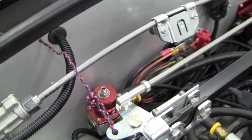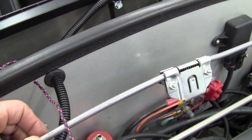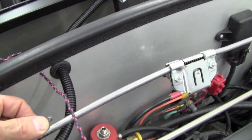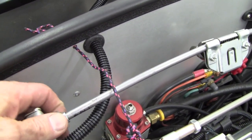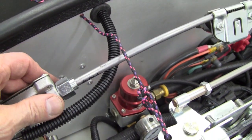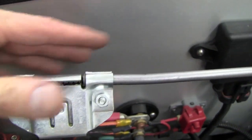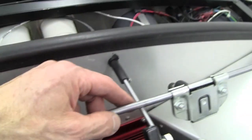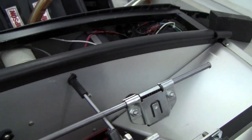Something people don't know about the wipers is that you have to have this tube nut here, and this tubing — which I think is 5/16ths brake line — and you make tubes to run the rack and the flexible rack or cable. You flare the ends, and when you flare the end you can really solidly attach that tube to the wiper motor. Your other flared ends end up right here in the little gaps in the wheel boxes. You go from the wiper motor to the first wheel box, from the first wheel box to the second wheel box. We even added a little piece of tubing out here just to enclose the end of the cable, which is oscillating back and forth.